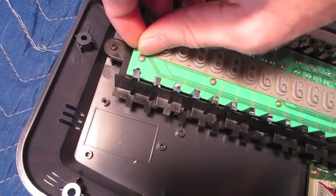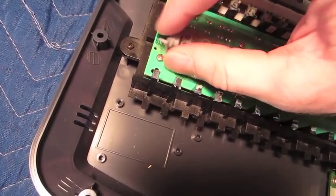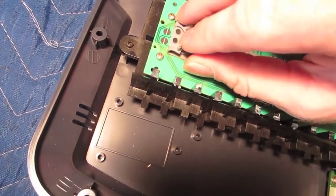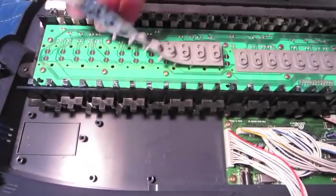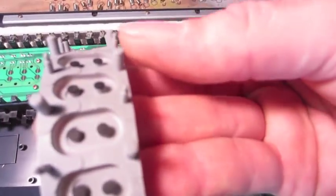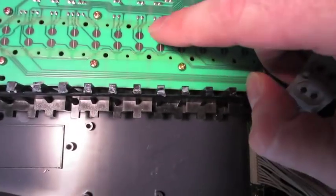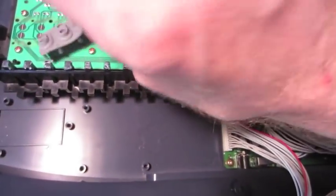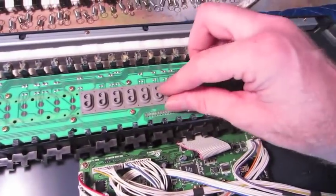So I'm going to pull off this rubber — I'll start over here. Rubber boot, gently pull out of the holes — just little holes that hold them down. And basically those are the contacts that we're having problems with. I'm going to pull that whole strip out, and then another strip, and then a third strip. That's what it looks like when you pull that first strip out. Those posts are stuck in those holes there, and these little pads touching those little circles is what makes the contact. Just make sure to get them all laid back in order — I'm going to lay that one right there and continue pulling these out.